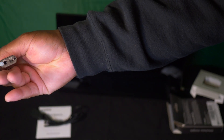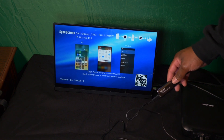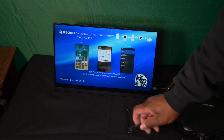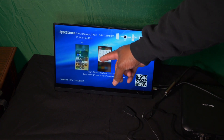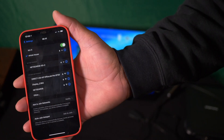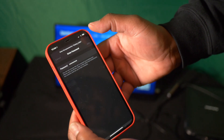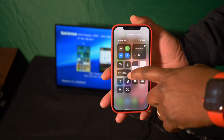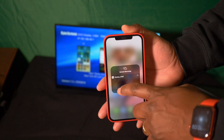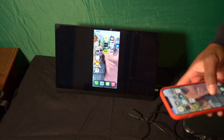With this portable monitor, it comes with an adapter — HDMI to mini HDMI. The dongle also has to be powered, so we have our little power bank here. Plug the extender into the dongle, plug in the power to the power bank, and this is the screen you're going to see when you hook it up to the portable monitor. Open up your Wi-Fi, put in the default password '12345678', and now you're connected to the dongle. It's broadcasting — go ahead, pair that up, hit mirroring, and voilà — just like that you are connected directly to the dongle.